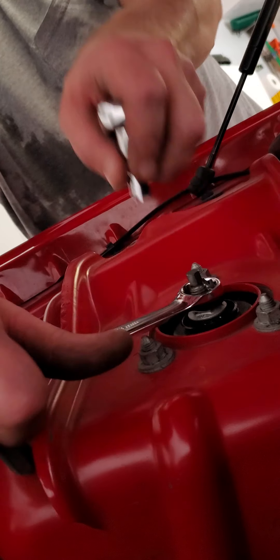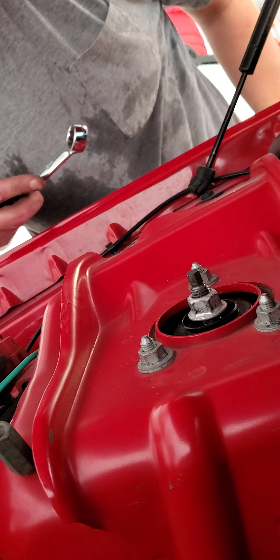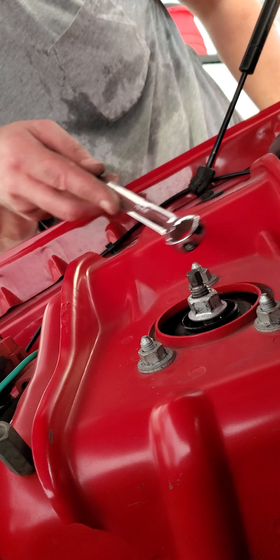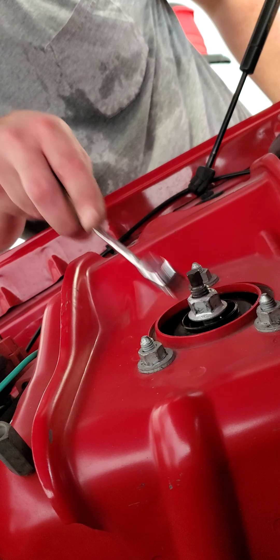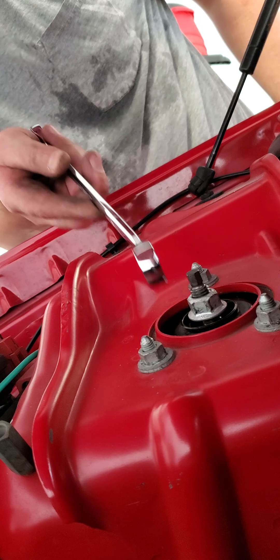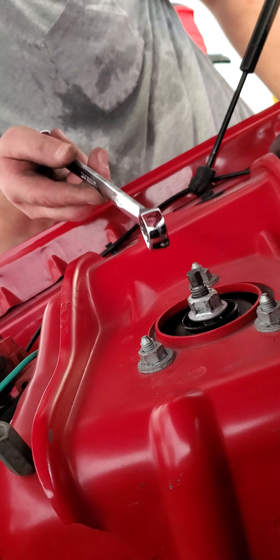Alright, so what I've got is everything put back together and I'm not tightening this until it's in the vehicle. It's jacked up to ride height so the top of the strut rod is bottomed out on the bottom of the strut mount.